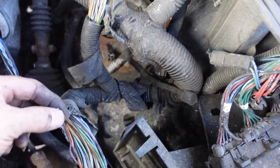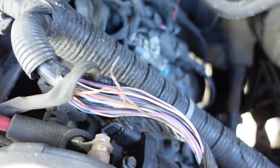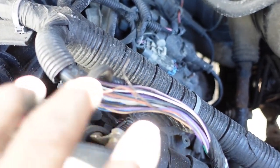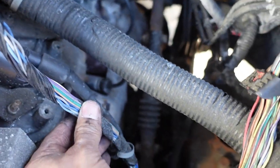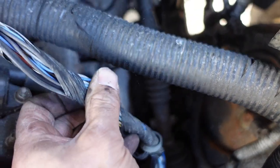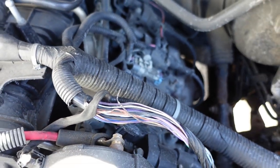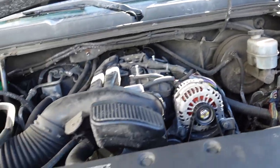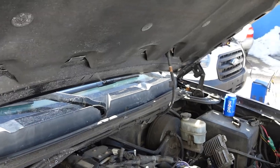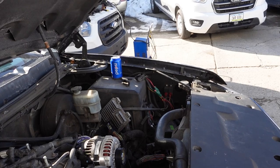After discussing with the customer and showing that the computer is able to supply a ground for the camshaft sensor, we're going to do a wire overlay. With this wire cut here, I'm going to take a lot of heat shrink tubing and run it all the way down to this terminal end, plus some liquid electrical tape. I don't like doing this because we could have another section of compromised wire that we don't see — I'm not a fan of it — but they know about the consequences. Some people like to watch this stuff, I guess.